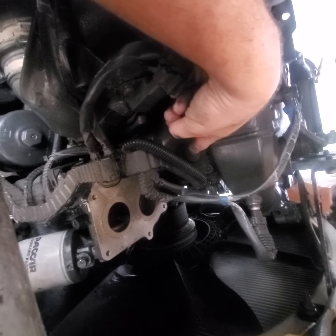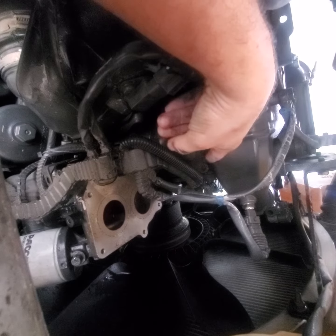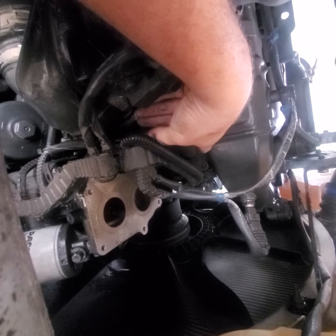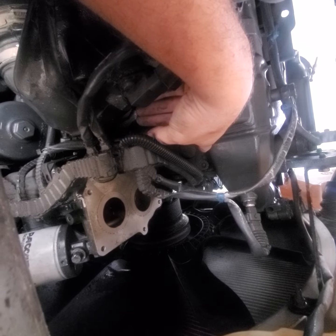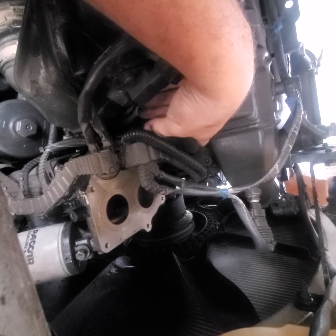The one that's back here was a bitch. I had to use a quarter-inch drive ratchet — the three-eighths-inch drive ratchet between the socket extension and the ratchet kept wanting to bind on the EGR cooler. I decided to use a three-eighths-inch drive just to break it free, get it out, and then use the quarter-inch drive to get it the rest of the way out.